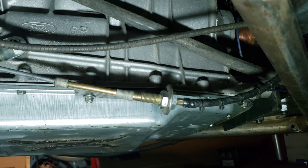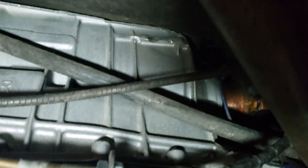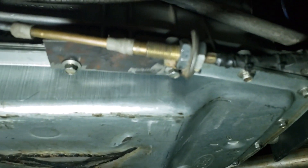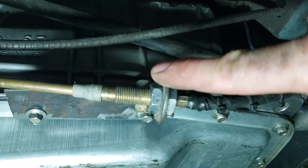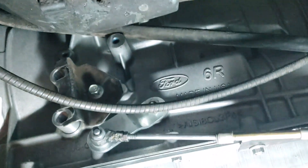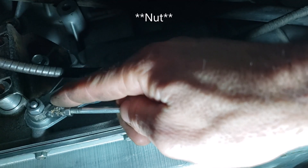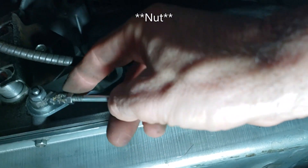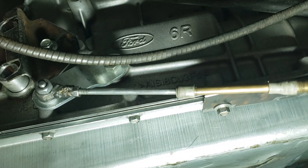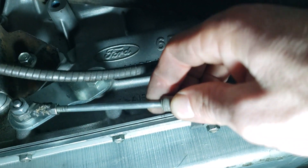You can also see my nifty little bracket I made for my shifter cable — just a piece of sheet metal with oil pan bolts and a washer welded to it. Just enough thread — almost screwed it up. It comes forward, and then I had custom 10-32s; I just welded a bunch of nuts together to create a collar and then welded that to the end of a bolt that I drilled the threads out of so it will slide on the shaft. I threaded the little nipple on the end of the shifter lever and threw a quarter-20 nut on top of that. It snugs up to the shoulder so you can tighten it just enough so it doesn't fall off, and then it has enough rotation and play that it rotates back and forth.